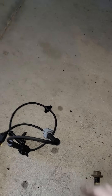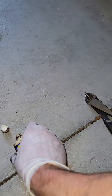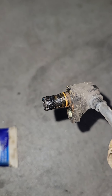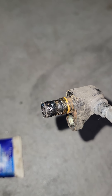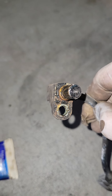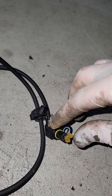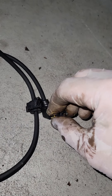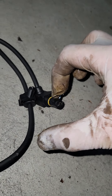Let's get this new guy installed. What I'm going to do is put a little bit of grease on the sensor itself to prevent corrosion — see what's happening here? And ideally you want dielectric grease. So I just get a little bit of grease, throw it on that bad boy. That's going to protect it from corrosion and also aid in sliding it in.